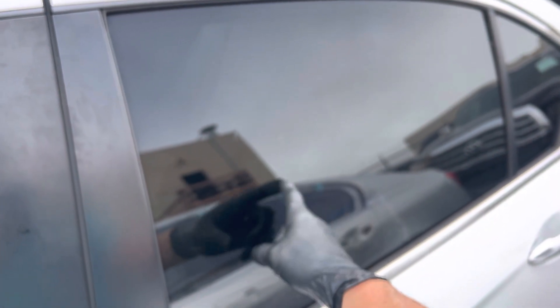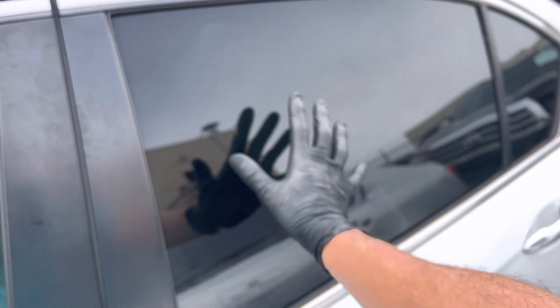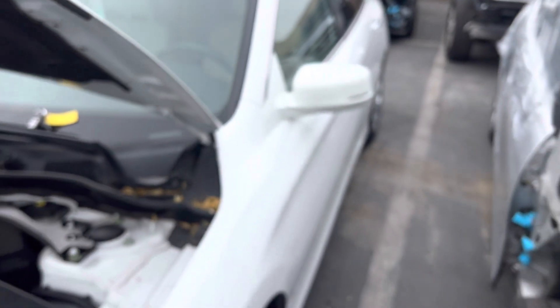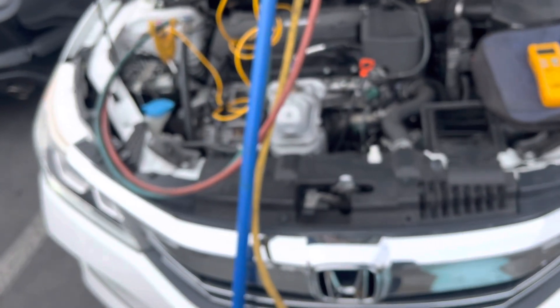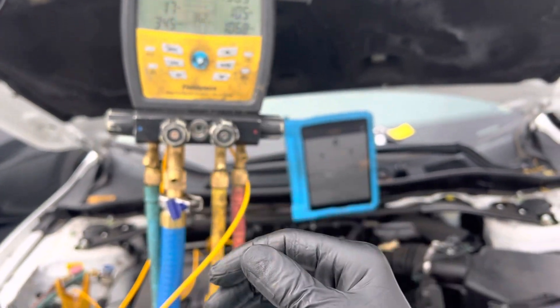This vehicle has tinted windows — light tint on the front, light tint on the side windows, and dark tint on the moon roof. This makes a difference. There are some cheap window tints that are dyes — really cheap — and the actual window tint gets hot because it doesn't reflect the infrared wavelength of sunlight. It actually absorbs it. It doesn't let the visible light through, but it makes the windows hot, and that's what happens when you get cheap tints.